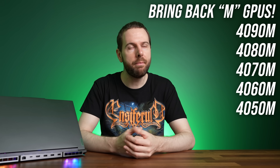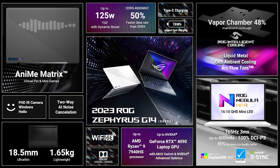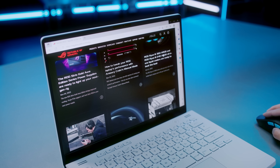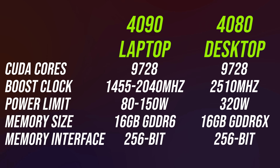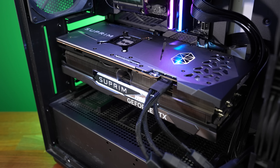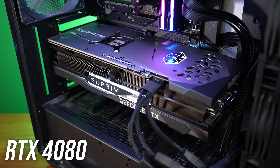I'm really not a fan of the same name being used for both the laptop and desktop GPU. I kind of get it from Nvidia's perspective — they just want to give the top tier option the same name. The main problem is that the desktop 4090 has been out for a few months now, people have seen that insane level of performance, and I think a number of people are probably going to be expecting similar performance from a 4090 laptop. The RTX 4090 is available in the ASUS Zephyrus G14, a 14 inch gaming laptop. But as amazing as that might perform relative to other 14 inch options, it's not going to touch a desktop. The RTX 4090 laptop GPU actually has the same CUDA core count as an RTX 4080 desktop card, though the desktop 4080 would still have a huge advantage with a higher power limit and much bigger cooler.